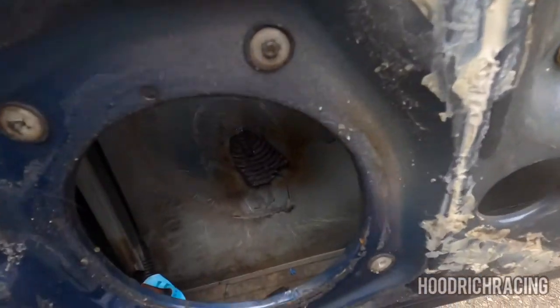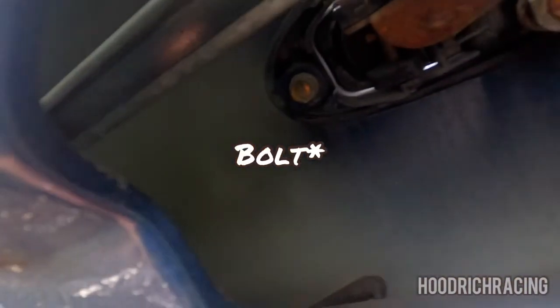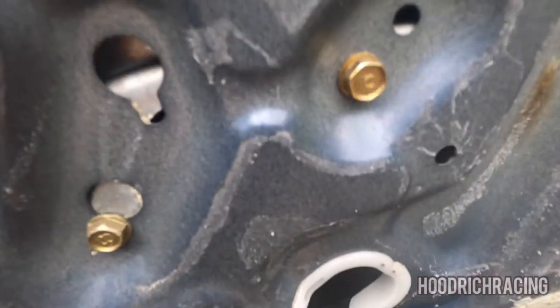So we're going to start by removing the power window regulator. I don't have power going to it. It might be an issue getting in here, getting that nut. There's a nut hole in the window on each side. This one's easier to get to, just right there. And then we're going to take out 4 bolts, 2 bolts for the regulator. Then we can put the manual one back in and do the same on the rear, because that's still power. That will sort of complete our DX conversion.